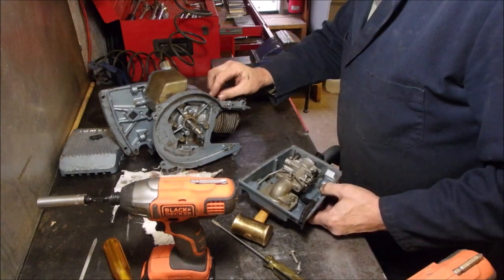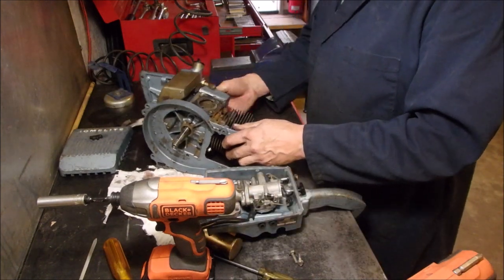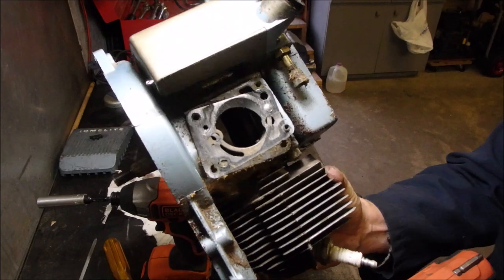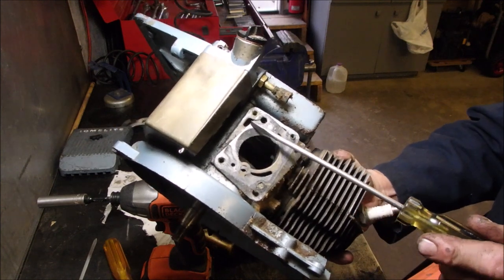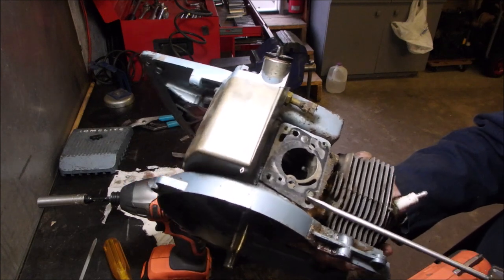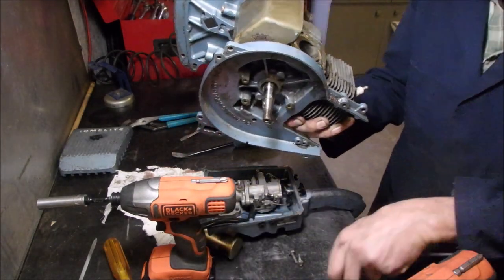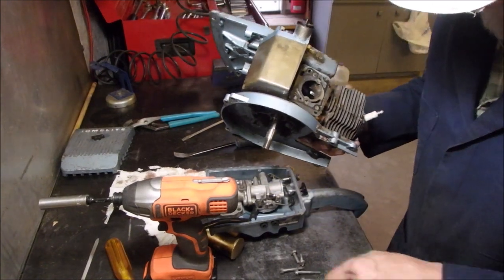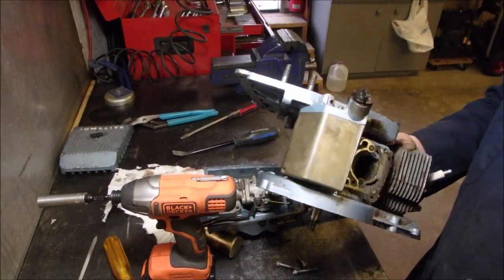Okay, thank you. But look at that. Amazing that it even ran. When you take stuff apart, you really learn. Really, really look at that gasket. You can see the ring around here, and the actual hole where the bolt goes wasn't lined up. And that's probably why they tried to use the longer quarter inch one. This one. So that's bad, bad, bad evil.